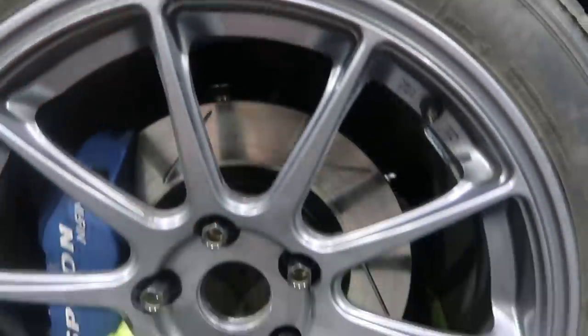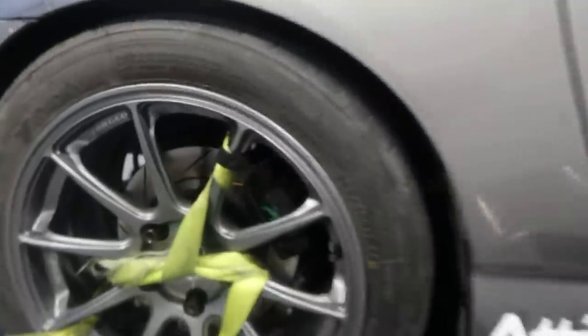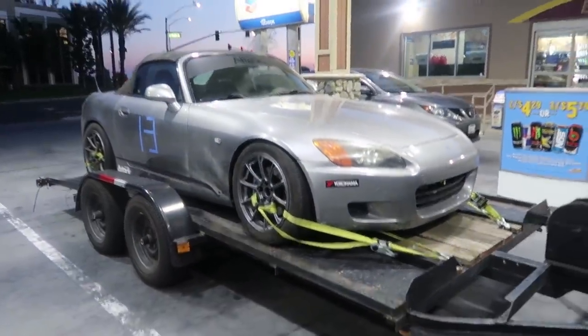Time to load this thing on the trailer and head home — we have a very early morning tomorrow. We got the car on the trailer, filled up the truck, and we are good to go. It's literally been such a long day but I am so hyped we got everything finished. Quick rundown: we need to bed in the brakes, so my first session tomorrow will be a 50-percenter braking hard. We got all the bushings, all the OEM arms, the alignment is dialed. My goal for tomorrow is to feel how the car handles now that everything's sorted, and give notes back to Art. We also toed it in a little more to prevent it from kicking out on the big fast turns.